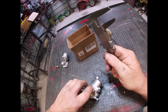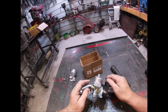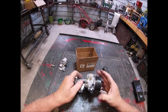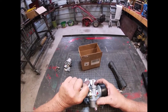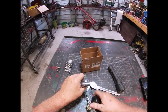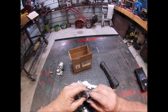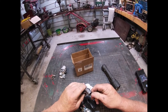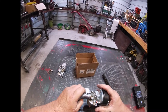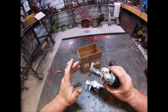This thing is not going all the way in there — all the way it could. You always have to clean up the casting lines and everything. I polished this thing and it still leaked up until I put the Ultra Gray in there, and then it stopped. That's when I knew it was this.